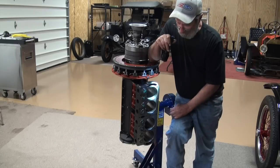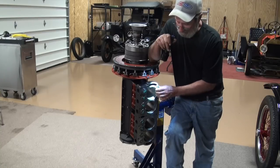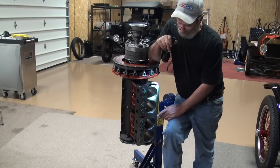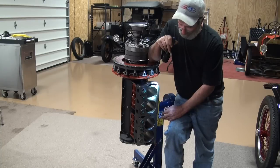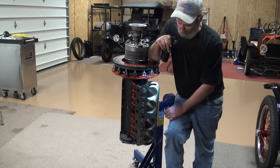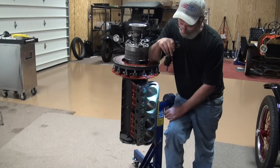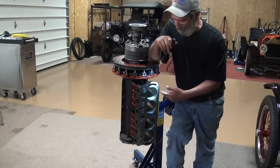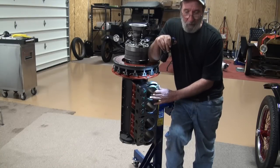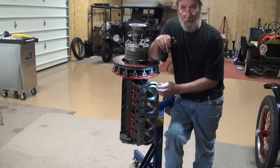Kind of get a feel for what you want. When you choose a size, you need to send those pistons to the machine shop so they make sure they get the proper skirt clearance on it. In my neck of the woods it costs about $100 a hole to sleeve them — prices probably vary across the country. So if the block isn't critical as far as the serial number or it being an early or rare block, and you find that you've got some issues in there, you might elect to go find another block. It might be cheaper all the way around.